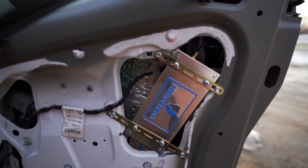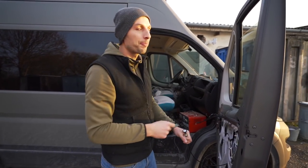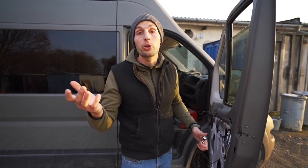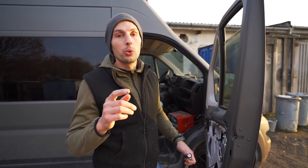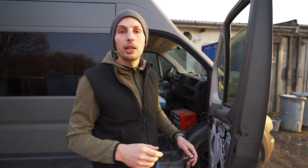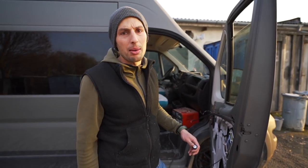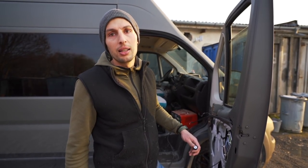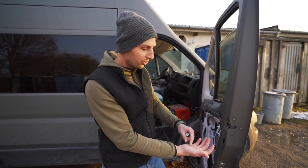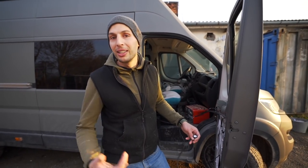Second row of security. There's a big argument because these work primarily on a remote control switch from the car. And there's a big argument, how are you gonna get in when your battery is flat? Which is a great argument. So I'm still sorting that out, but most probably I'm gonna use a 230 car battery charger that's gonna be sitting in my electronics box. And ideally I'll be able to turn it on and start charging from the 48 volt leisure battery. That would be really easy, that only draws a few amps. And with that app, we can always keep track of the battery too, which is really nice. Exactly. If it doesn't unlock, I can check the app, see, oh, the battery is discharged. Turn the switch on, start charging it from the leisure battery, and be done.